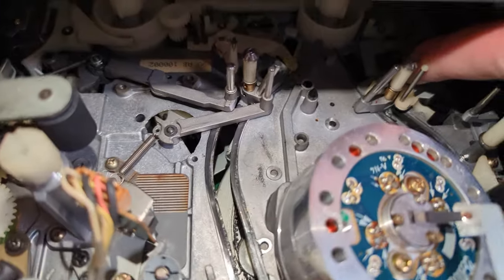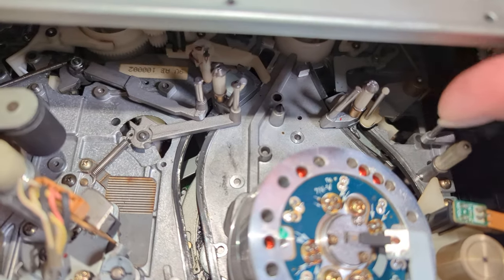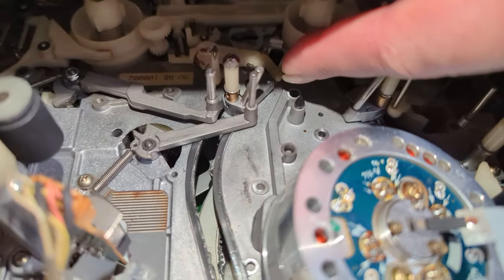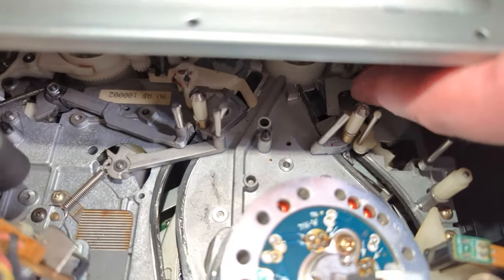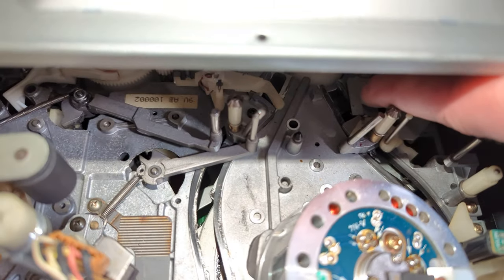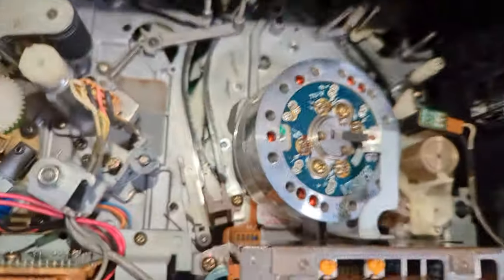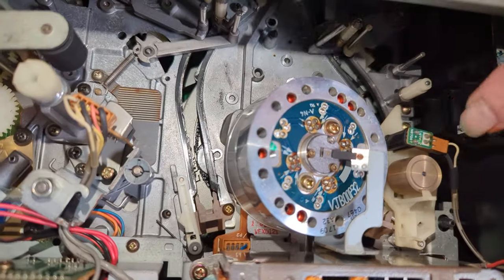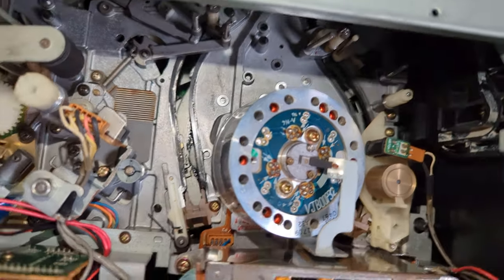It's the parking brake or parking end for the standard size cassettes. It's plastic on this side. Well, this is actually an actuating lever here. It's really very difficult to film, which, like I say, moves the LED in for VHS-C. But this side, it actually rests against it. When the VHS-C compartment comes up, it unlocks that lever, and that lever moves out of the way. It moves outwards that way, so towards here, to allow this then to move back. But yeah, it's just crazy.